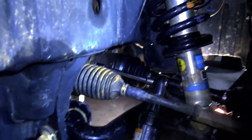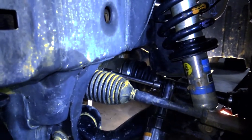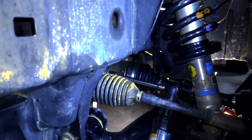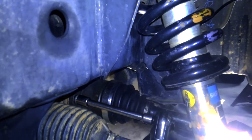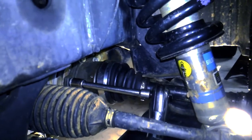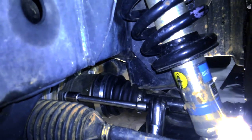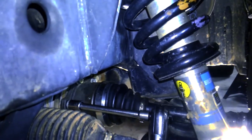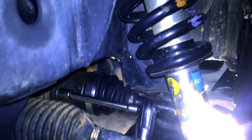I'm going to leave the CV axles in, hoping for the best — just hoping to find the issue and slap the M205 back in within the next week. I take the wheels off; it's just a 14mm. Normally with the wheels off I'll use an impact with a long extension, turn the hub, and get one bolt at a time. That's been the quickest method — using a swivel and extension, working from the same angle the whole time to get around the shock, since all shocks are different sizes.